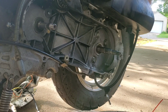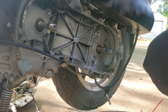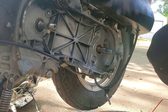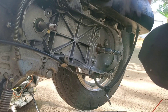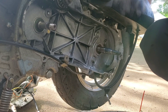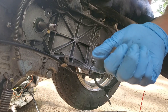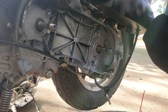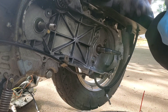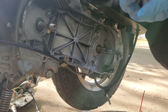Do you want to reuse the original weights? I don't know what the difference between any of them would be. They're five-gram, so I would probably use these personally because they don't have any flat spots yet and in theory were working fine before this happened. I just think that if we use those eight-gram weights it's going to really dog along on takeoff — it might eventually get alright at the top end, but you're not going to get any better top end.